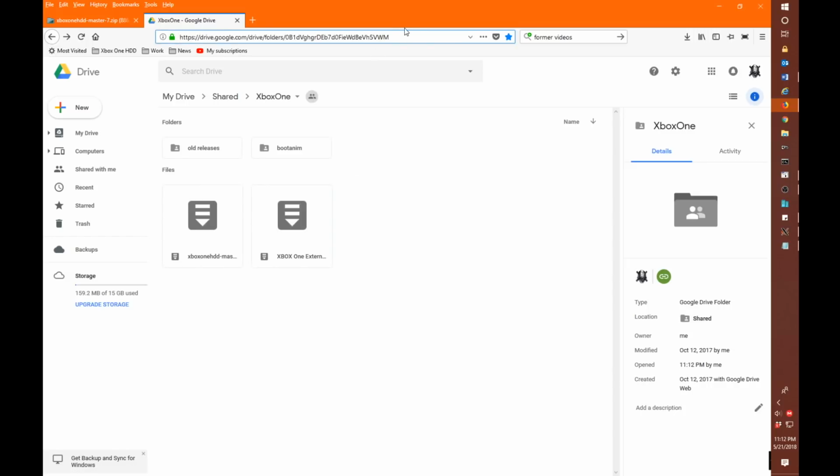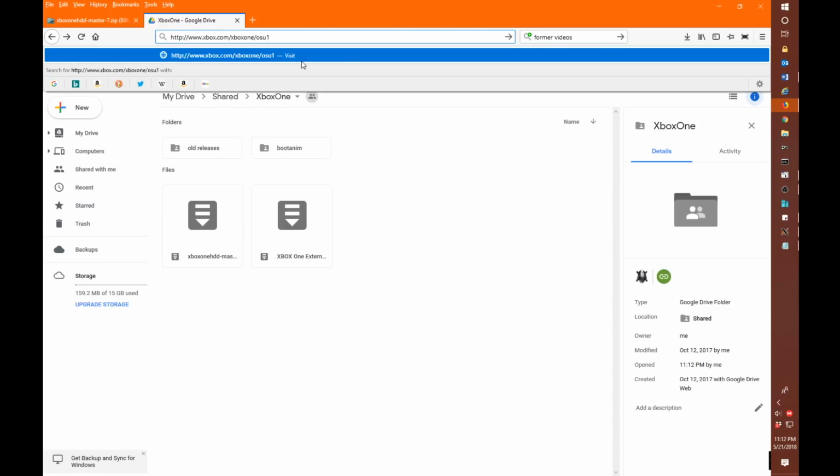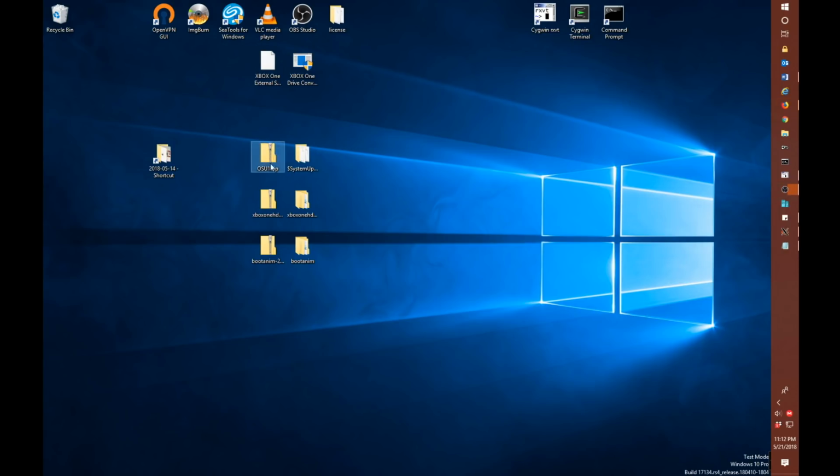Now, the last thing that you want to download is the latest OSU1. If you're on a preview dashboard, you may have to wait a little bit longer than other people, since you have to make sure that the latest version of the OSU1 is past your current preview dashboard version. But for most of us, the latest OSU1.zip is fine. So basically, you'd want to use this URL, which is linked in the description, and that will download this OSU1.zip here.